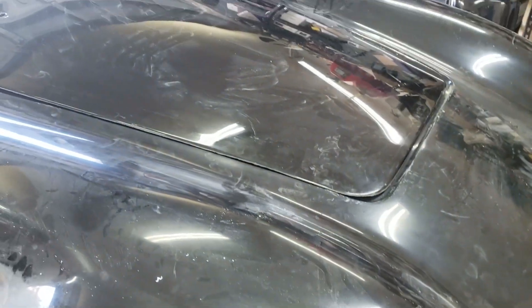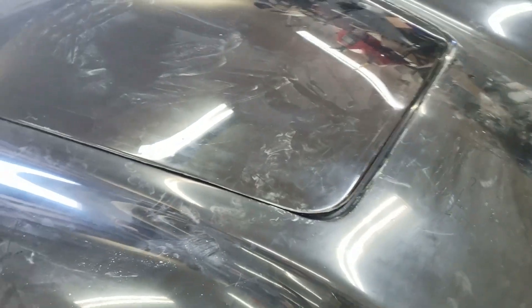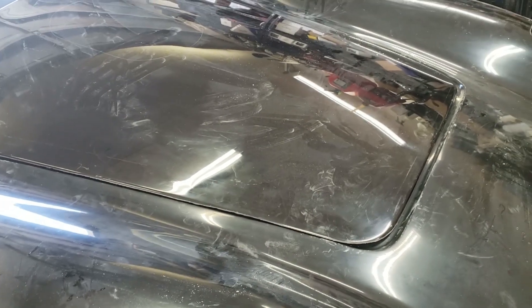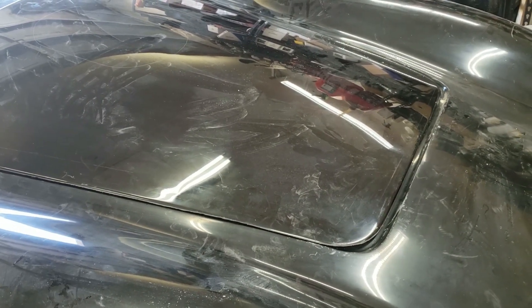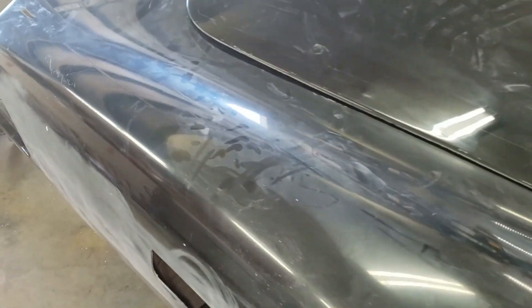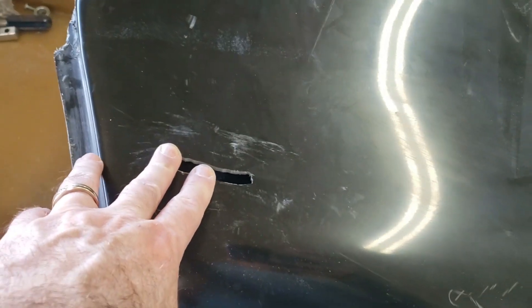Just to rehash what I've done today — the hood is on it but we've got some fitment issues. The whole hood needs to shift that way. What I think I'm going to do is widen the holes on the U-bolts that mount the hood and move it back — that should hopefully buy me enough room. The windshield areas are good to go, and I've got the pilot holes drilled for the windshield wipers, so those are located and ready.